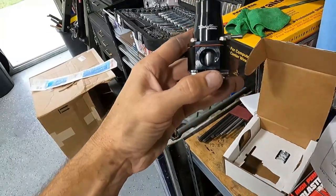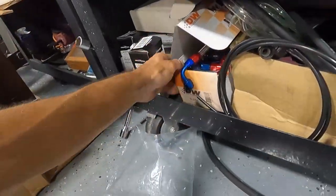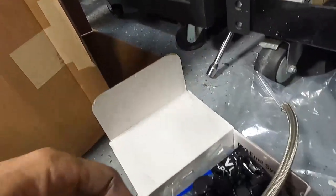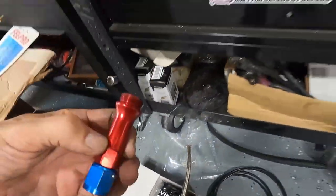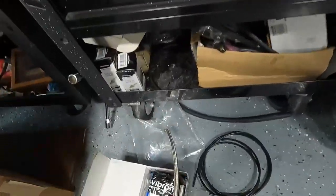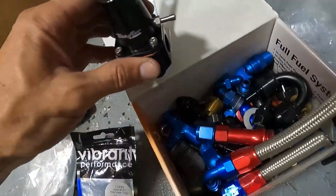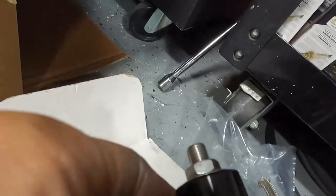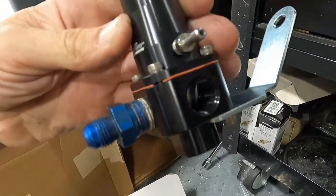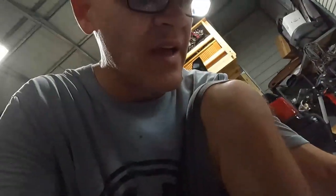The Aeromotive one was a little bigger and I don't need that. This has 3/8 NPT. I wanted to check what fittings I already had before ordering anything. I've got some fittings for the carburetor itself — extensions — and I found a dash 6 to 3/8 NPT fitting, and I have a few of those. I wanted to go through my fittings first before ordering any.